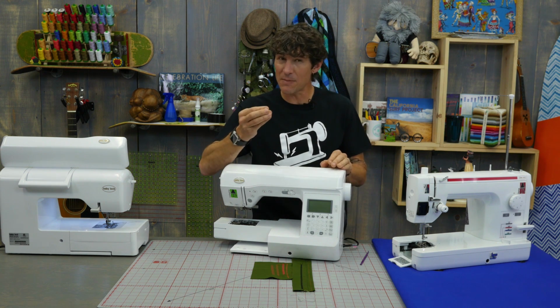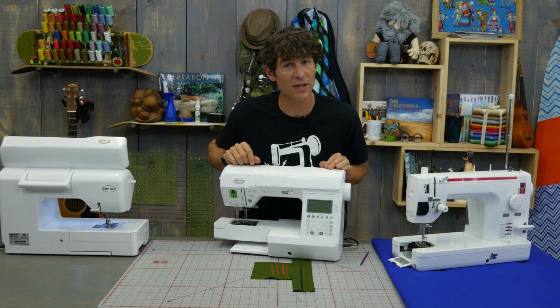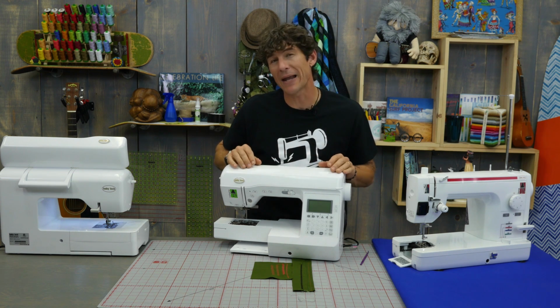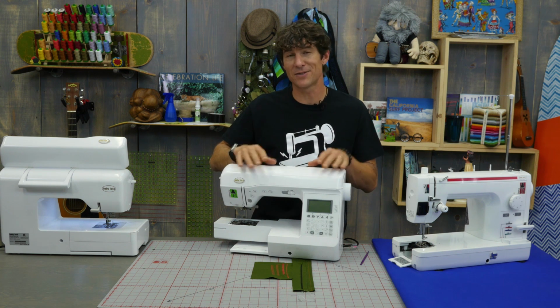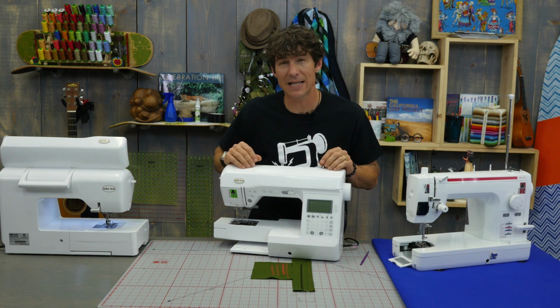I may have a slight timing issue, and the time you're going to see that the most is when you're doing free motion machine quilting, because the effect of that stroke sometimes gives us an erratic looking stitch with our body mechanics. So it would sew beautifully until we get into free motion, and that timing might be slightly off.